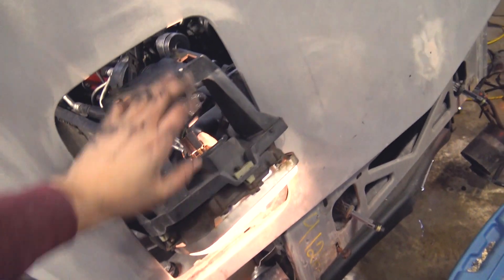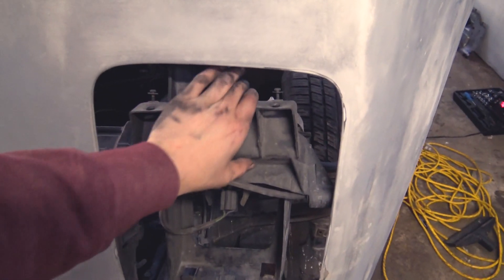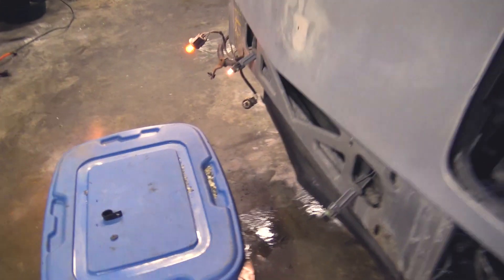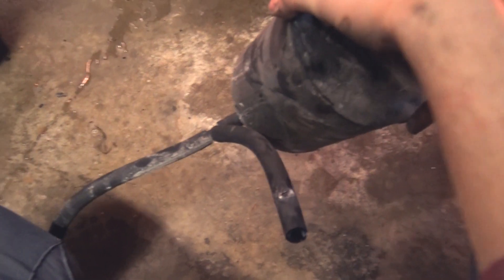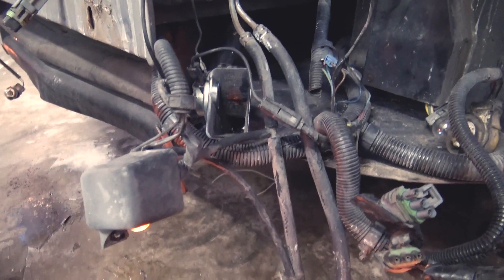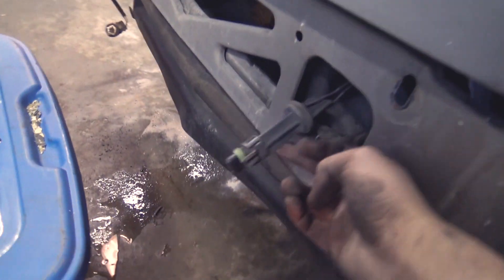It's been a pretty long day. I still have to order the part that got smashed a couple months ago, and figure out why this one doesn't pop up — sometimes it does, sometimes it doesn't. Once you have all the bolts off, this is held on to the bumper by a little bracket — just loosen that one bolt and it comes right off. Make sure you take all the wires off first: lights here and here. It's a pretty long job — takes about a couple of hours to get that off.